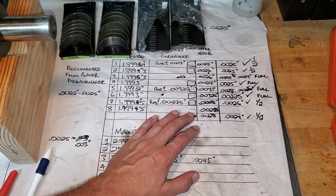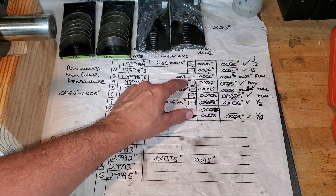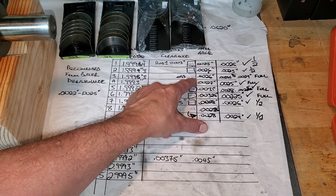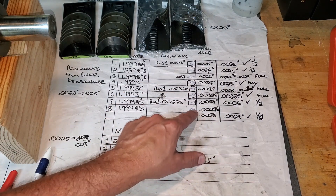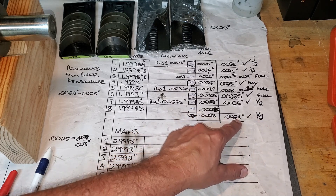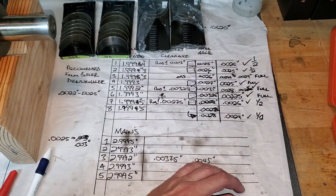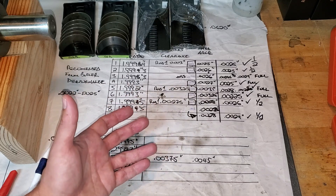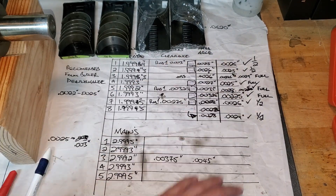I went ahead and re-measured everything. The ones I put a square next to I agreed with. I tried my best to match one measurement but it was a little under, so I still did a full bearing swap since the professionals measured three and a half — a full bearing swap brings it to two and a half. I came up to 2.4, which is fine, still in spec. Number eight I could only read a little under three, so I did a half bearing swap and got to 2.4 — still in spec. I did half bearing swaps on one, two, seven, and eight, and full bearing swaps on three and four — which makes sense because those had the worst scoring and needed more polishing. If anyone tells you polishing doesn't remove material, they're wrong.